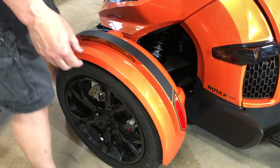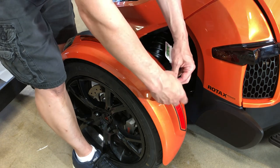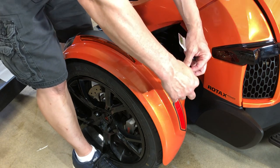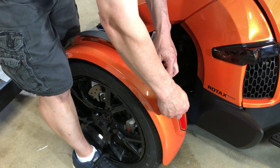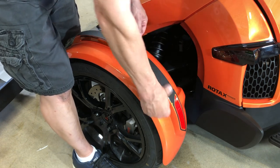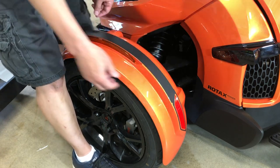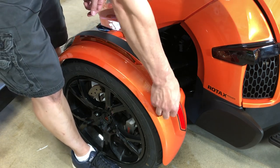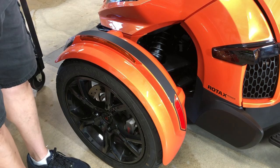In most circumstances, if you wanted to reposition, you can carefully pick up the edge and still pick the film up and work with the raw material. See how easy that came up? Because you haven't post-heated yet. And then you can lay it back down as you desire — I'm not even using a squeegee, I'm just rubbing it down by hand. You have the ability to position it as desired.